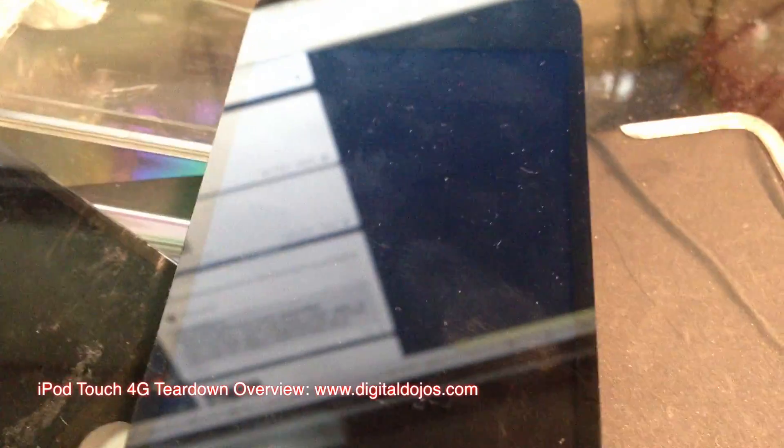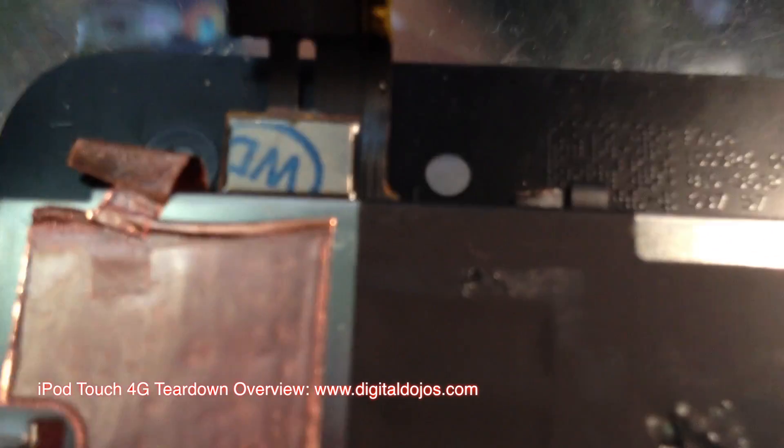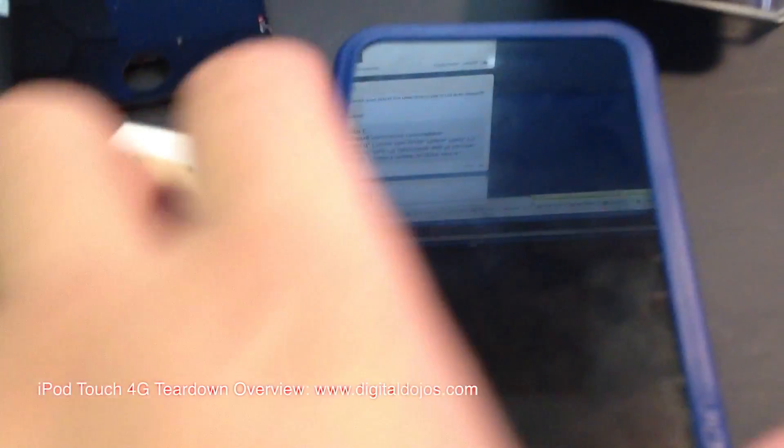To be honest it's not as hard as you think. I've gotten a lot of old screens — stuff that doesn't even look broken is actually broken. You can see these old screens from the iPod Touch 4th Gen right here. This one has the LCD broken — you can see the liquid inside. This one looks perfectly fine but has a broken cable on the back. Appearances can deceive you. Anyway, this new screen is fine for my customer — everything is good to go.